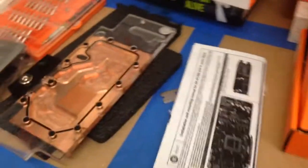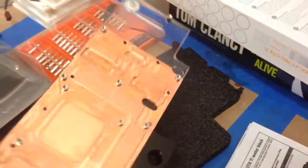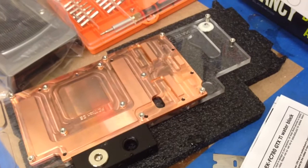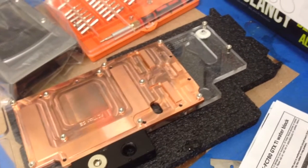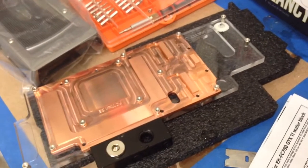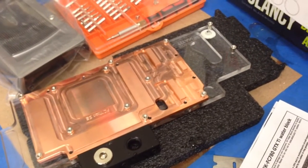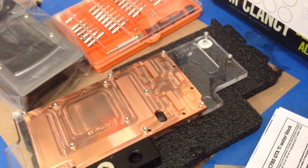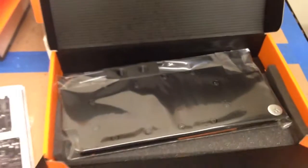That's pretty much what comes in the box. There's not much to it; the instructions are pretty easy to assemble and self-explanatory. The reason why I went with these — and why I'll recommend them to anyone with a GK110 card — is because of the active VRM cooling. The only other model that does that is the XSPC. Heat Killer and Aqua Computer have very nice looking blocks, but they don't offer the performance that these do. Thanks for watching — hope you enjoyed my brief unboxing of a great product that I recommend.